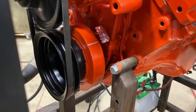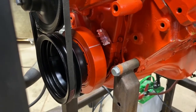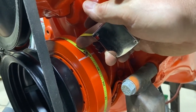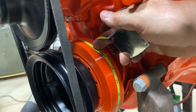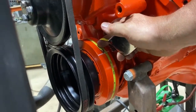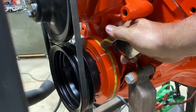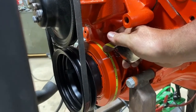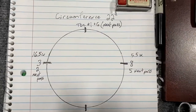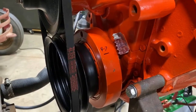I'm right at zero. I'm going to rotate the engine over 90 degrees and then go through the firing order, which on a Chevrolet is 1-8-4-3-6-5-7-2. I'm going to put a mark every 90 degrees on the balancer. I took a tape measure and measured all the way around the balancer — it's 22 inches. So I'm going to divide that into three more lines with a sharpie. Every five and a half inches on the balancer I'll put a mark: five and a half, eleven, sixteen and a half, and zero is already there.